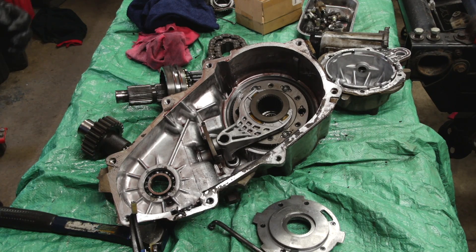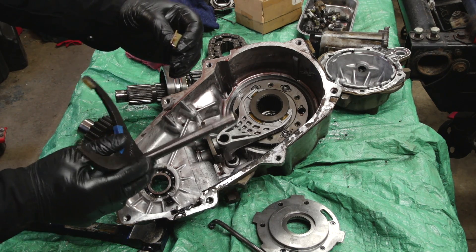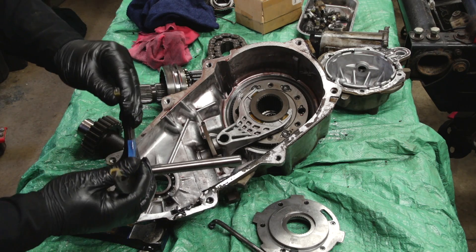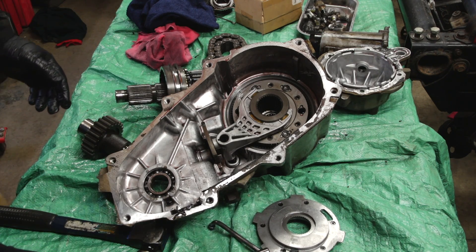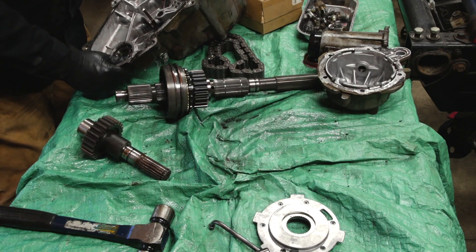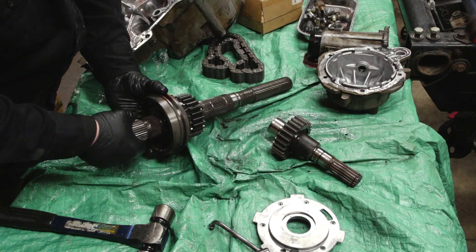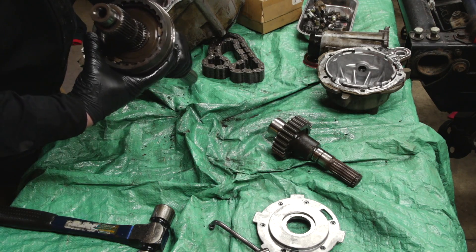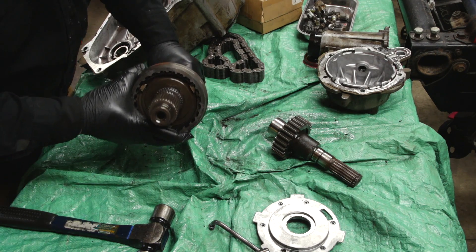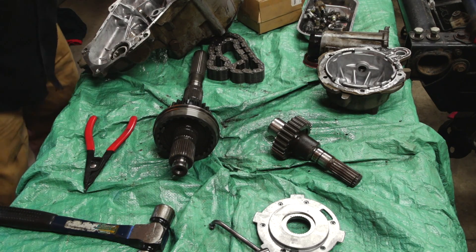I got the transfer case split and the gears are out. You want to pay attention — the rebuild kit comes with these plastic pieces, but this one here is already broken. If your transfer case is missing these plastic pieces or they're all broken, you've probably noticed it's shifting funny. There's one shaft, and this is the other one, and there's another one of those snap rings right there that nobody likes — we're going to need to pull that apart, and then the main shaft itself will just pull out of that section.